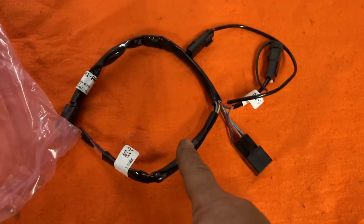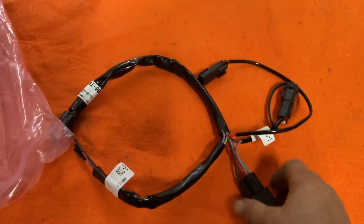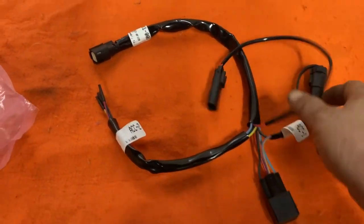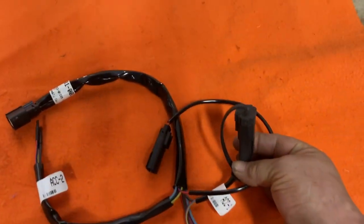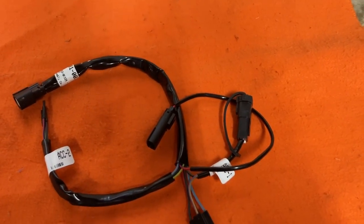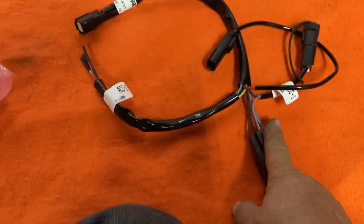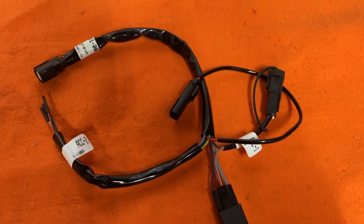The wiring bundle is pretty much straightforward. You have plugs that relay and plugs that plug directly into existing connectors on the Harley. This gives you an accessory plug and runs two switches. This right here plugs into accessories the Harley sells and it's for two amps or lower average. This is to be able to wire in through the relay power up to 10 amps, with a 20 amp fuse in the Harley wiring.